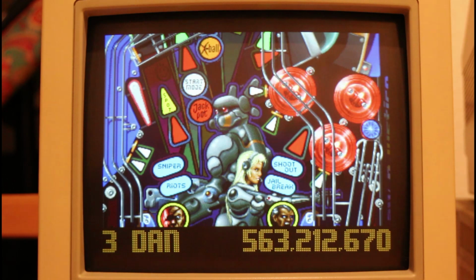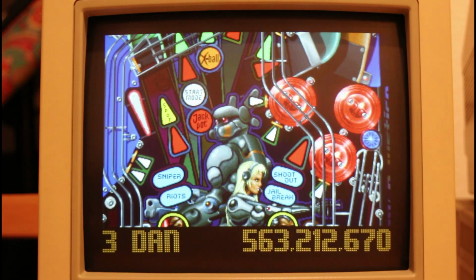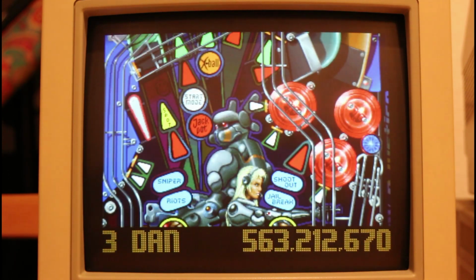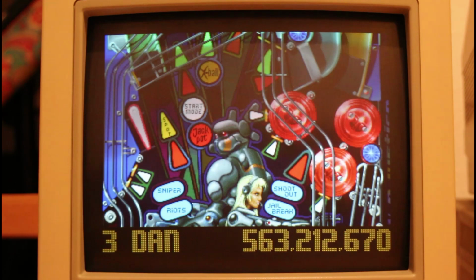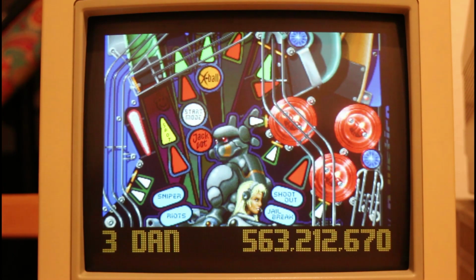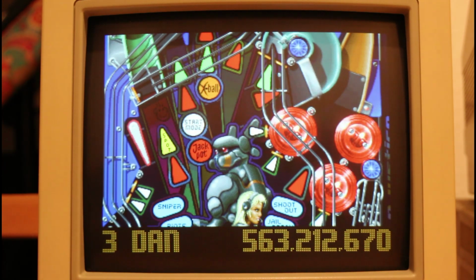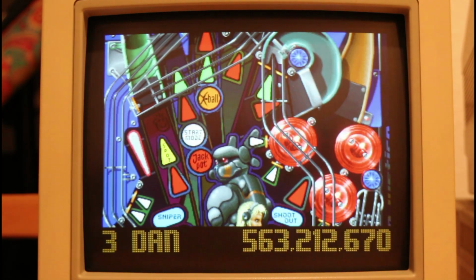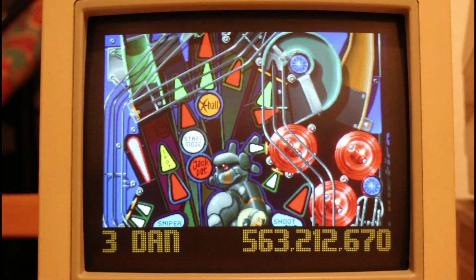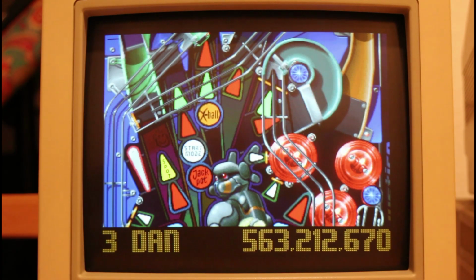There's no flicker in this mode, and that's because the 60 Hz that this uses is matching up with my camera. Basically, the VGA 640-480 resolution uses 60 Hz instead of 70. And because this is just doubled in each direction so that it gives you effectively 320 by 240, it is still underlying a 60 Hz mode. And so that's why you're not seeing flicker.